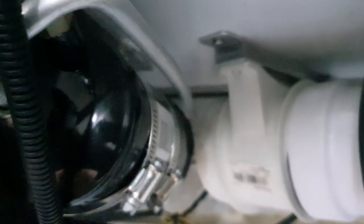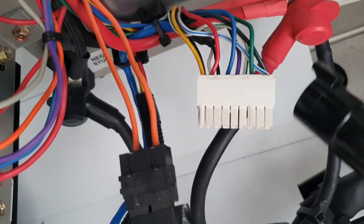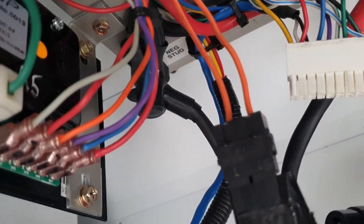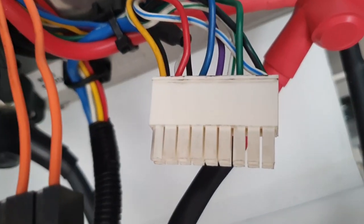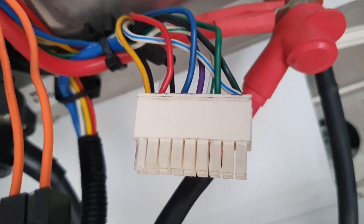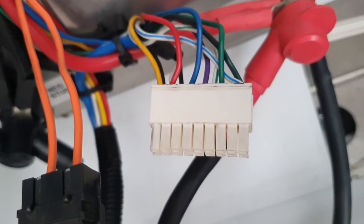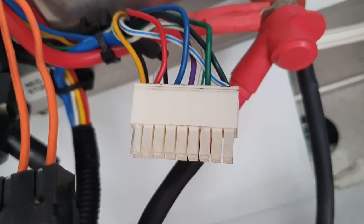That's your dryer right here. Before you start cutting wires or anything, make sure you know what all of this is. Luckily, this controller unit has a description of all of the connectors. Now remember that an AC system has a compressor in the front that's driven by the engine belt — that would be the red wire on this connector right here. Then you have the yellow wire which is the water pump, which will pump coolant into your system and you can use it to heat. This blue wire is our condenser engage, the purple one is our pressure in, and the green one is our thermostat. We're going to use all of these to wire up the relays and make this system work pretty much autonomously.